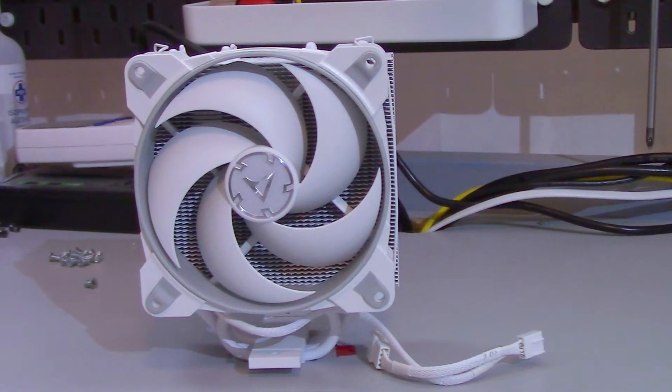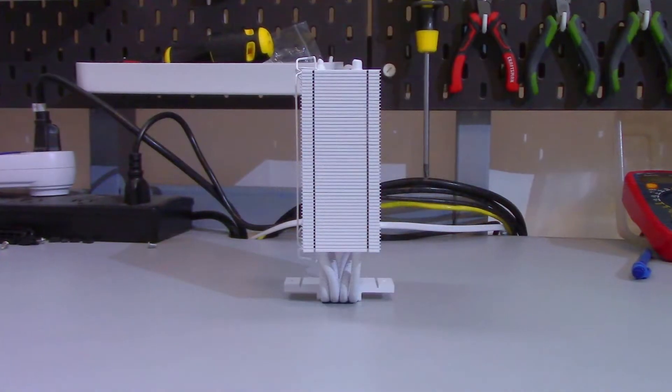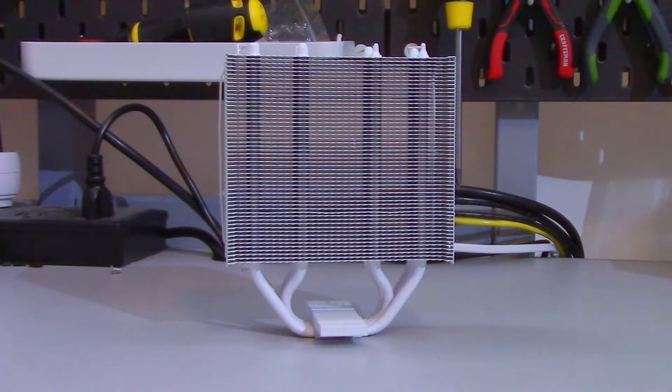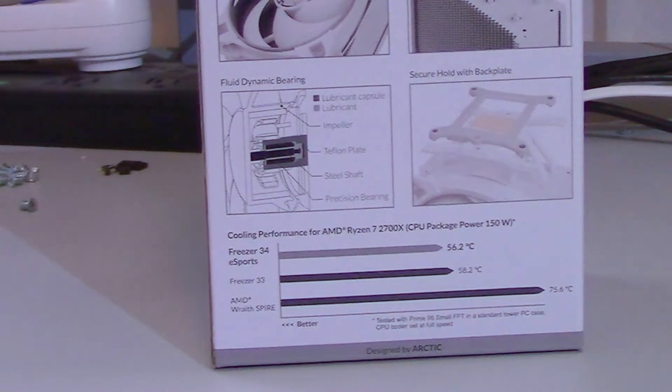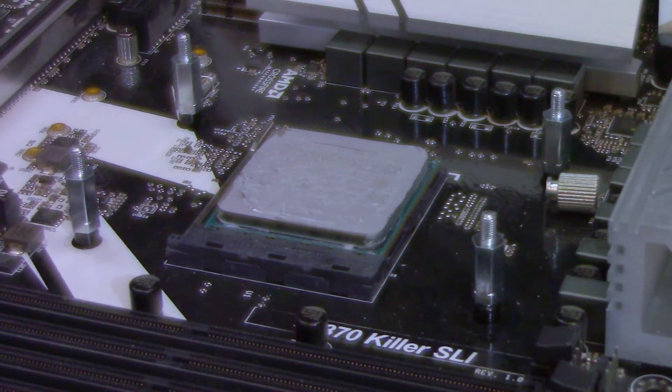So what do I think of Arctic's Freezer 34 eSports? First off, it's a horrible name — I'm sorry, but it is. But it performed pretty well in both the 87-watt and 150-watt testing. The P120 Bionics fan is quiet while still doing what it needs to do. The build quality and design of the heatsink seems pretty good; everything feels solid. Installing this CPU cooler was really easy — it's definitely a plus not having to fight with weird brackets. I would personally be comfortable pairing this with anything up to an R7 or an i7, and doing so would likely give you some overclocking headroom as well. But I think a 5900X or Intel's equivalent would be too much for this cooler if you have a heavier CPU workload. On the AM4 socket, the cold plate doesn't cover the whole IHS, which seems a bit odd, though it didn't seem to affect cooling performance in my testing.